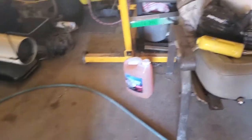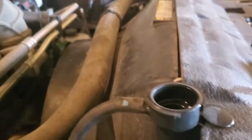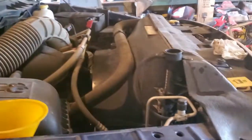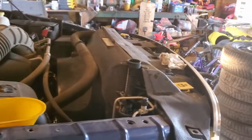We're now just running it. A bunch of it just went down — thermostat must have just opened. So we're going to let it run for a little bit and keep topping it up. After looking at it, it still looks pretty orange. The thing that concerns me is I've already put in almost two full jugs, and one and maybe a half came out if even. I'm about to add some more in because it looks like the thermostat just opened, letting a whole bunch more circulate through the heads. So we're just going to keep adding until it's full, let it run 10 to 15 minutes, get up to operating temperature. Heater's on high, so we're going through the heater core.